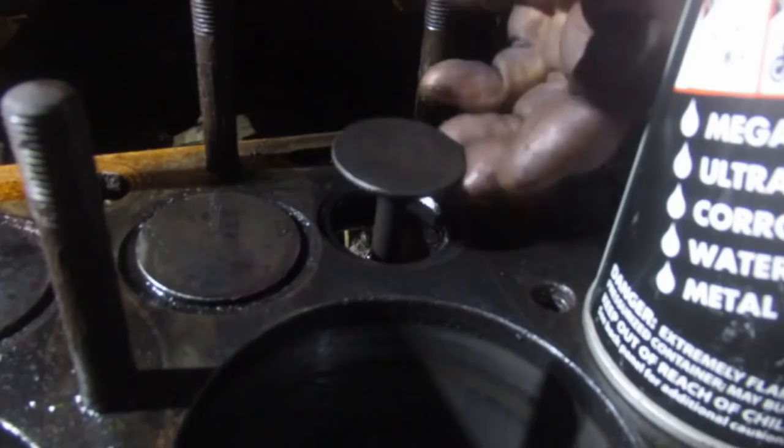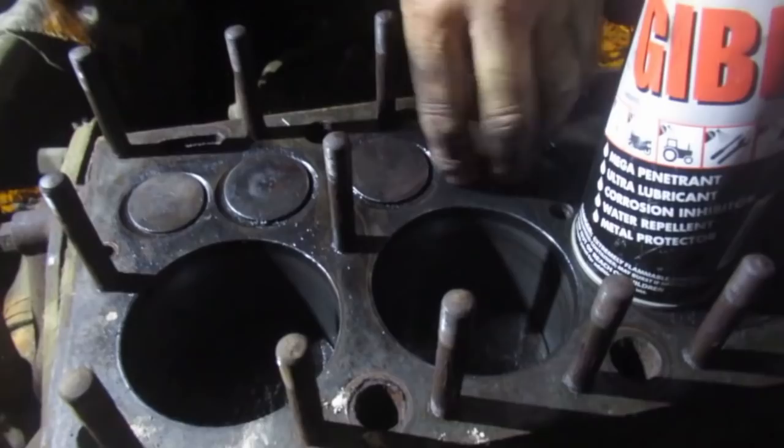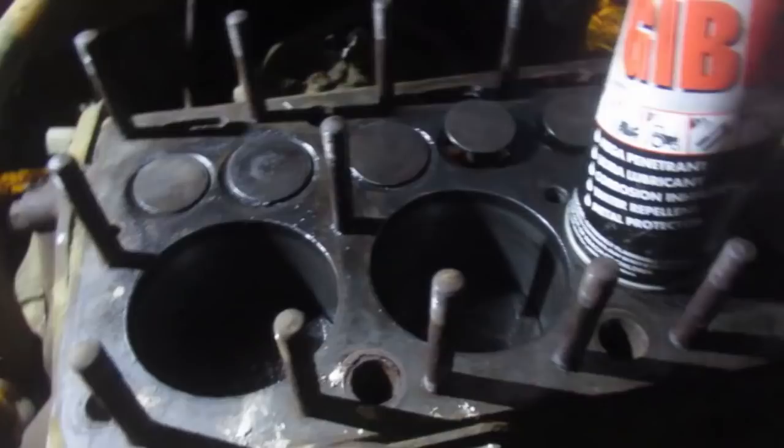It makes me think though, that's a lot of work pulling that valve up, but I guess look at the results. Now it goes from being that was going to fail to that's not going to give any trouble at all. We put the little vacuum cup thing on there, give her a lawnmower lap in there, you know? A little wipey with the lappy. I don't think they even need a grind. Let's have a look at the edge. Look, there's no wear at all on those.